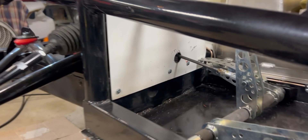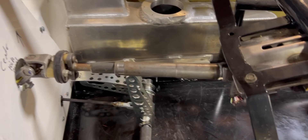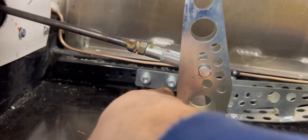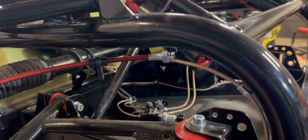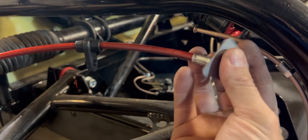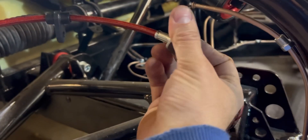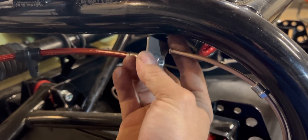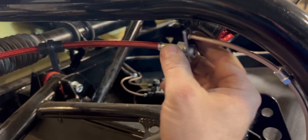It's really easy to adjust — after you break the lock nuts, this part right here after I welded it I made sure to grind it down so it still has flat areas. You can just put a 13mm wrench on there and turn it to get the rod length exactly where you need it. And if I really needed to play around with it, I've got all these other holes for adjustment, plus the whole pedal assembly can move forward and backwards. Since I'm already doing brake stuff, the next thing I'm going to tackle is putting these brake hose brackets on — I need to weld them on, grind them down, throw some paint on.